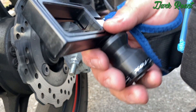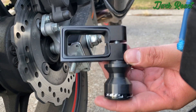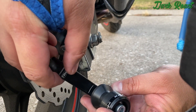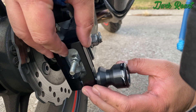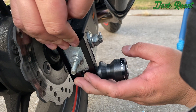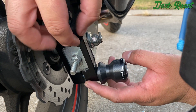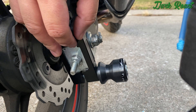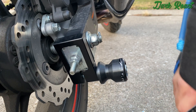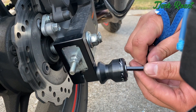You can see it's got a plastic gasket type thing, and we're going to put it over the swingarm end and flush it. There's a little notch at the end where it just caps off the end. Then we're going to get a six millimeter hex key Allen wrench and just tighten it down.